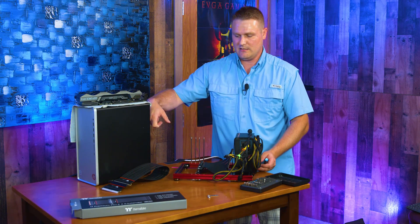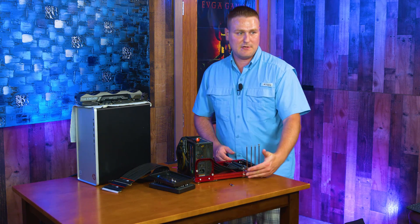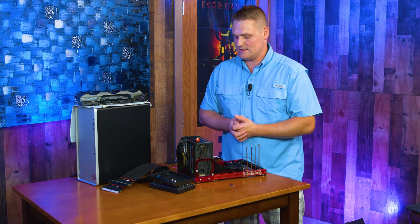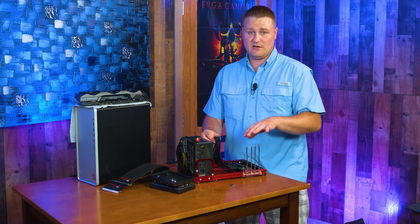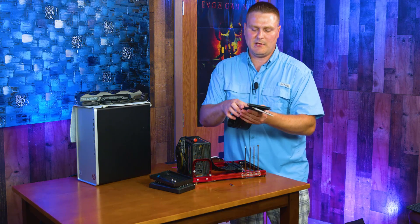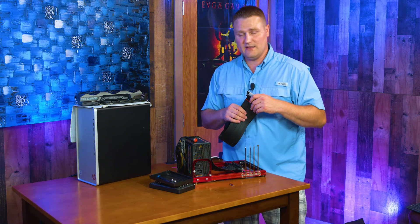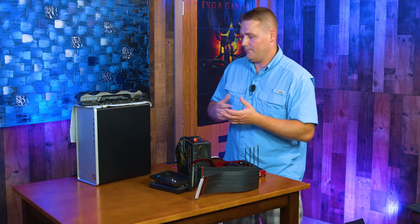The test bench is ready to go. I'm not gonna put the graphics card in until we get the PCI riser cable attached inside. Now if you're wondering about running a computer with two power supplies: the only thing connected to the computer is this PCI bus lane — it doesn't care where the graphics card gets its power from. And testing so far, I have not seen any negative consequences from this PCI riser cable. I've seen more negative consequence from only having an i5 with a 3090 versus an i7, i9, Ryzen 7 or Ryzen 9.